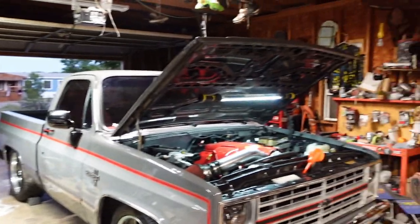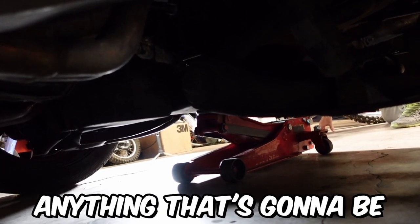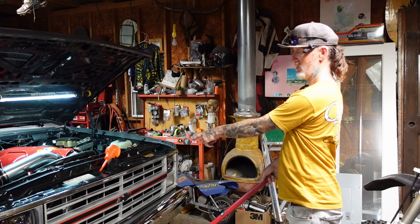Next, we're going to take this jack and we're going to go center under the license plate underneath the pickup. You want to get on something metal here. You don't want to jack on anything that's going to be light because you're jacking up something that's several thousand pounds. So center of the motor dead underneath — you've got a crossmember. Put it on the crossmember.